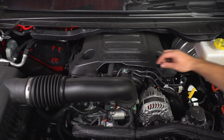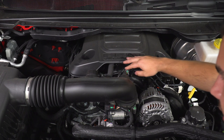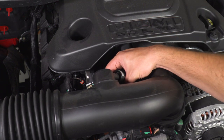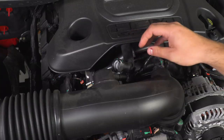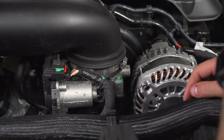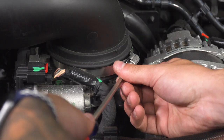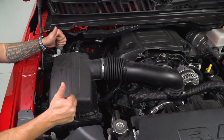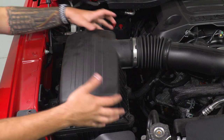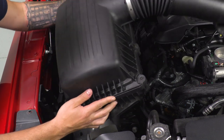First step, you're gonna disconnect the temp sensor just by disconnecting that harness — just pinch and pull back. Next, we're gonna disconnect this hose to the left: push up on that gray locking tab from the bottom and pull straight back. Next, take a flathead screwdriver and loosen up the clamp connecting the factory hose to the throttle body. Now lift straight up on the airbox to disconnect — there are two little rubber plugs retaining it in place, so just pull and disconnect it, and set it aside.